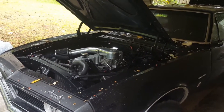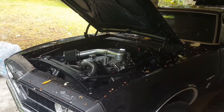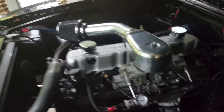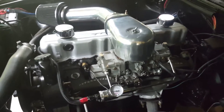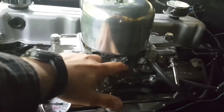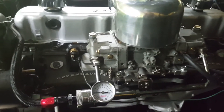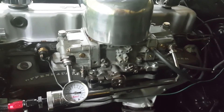I'm not a carburetor expert, however I've watched enough YouTube videos and have enough previous experience to diagnose most carburetor-related issues. I have one here that I'll go through with you. It's a Holley 600 CFM double pumper with mechanical secondaries. I've removed the choke — it's just sort of fast-idling around there — and otherwise it's set up generally correct, but keep in mind this is a straight six Chevy 250 engine, so this carburetor is on the very large side for it.